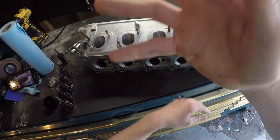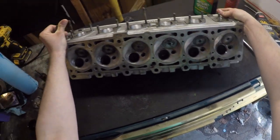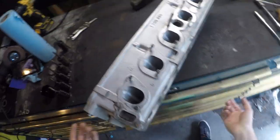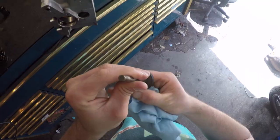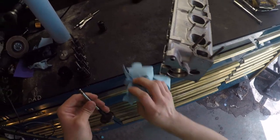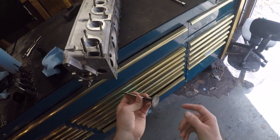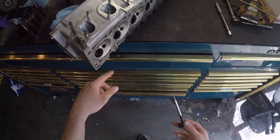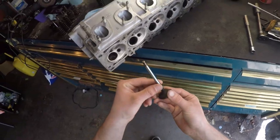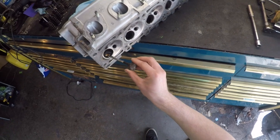So I've got my headset on so you guys can see how I do it. All the intake valves are actually already in, so now we're going to go through and do all the exhaust valves — exact same thing. Now these aren't new valves. Obviously when you put new valves in they're going to be a lot cleaner, but the reason I'm not doing new valves is because I don't want to wait — there's nothing wrong with them other than being dirty. And if I changed to new valves, I'd have to change the valve stem guides as well, which are what actually hold your valve stem seal. Because if it's worn in there and it's not worn on the new ones, it's going to end up wearing way worse than just putting the old ones back in.